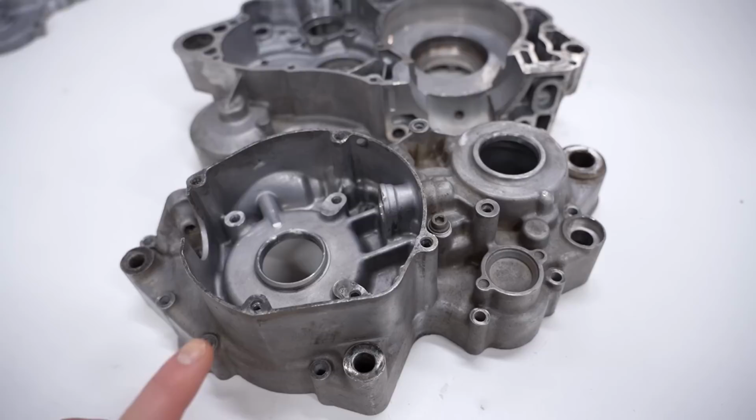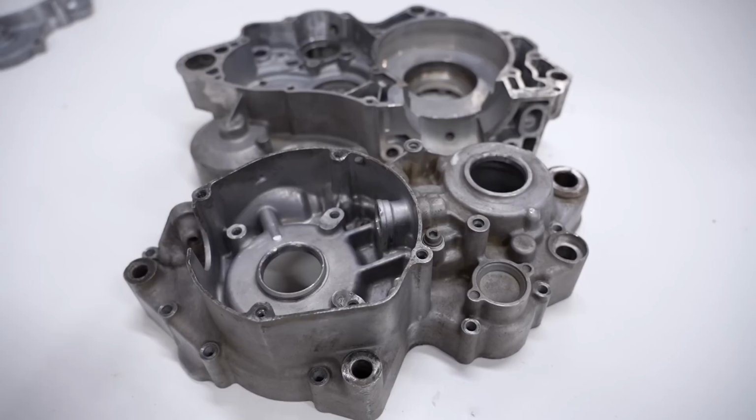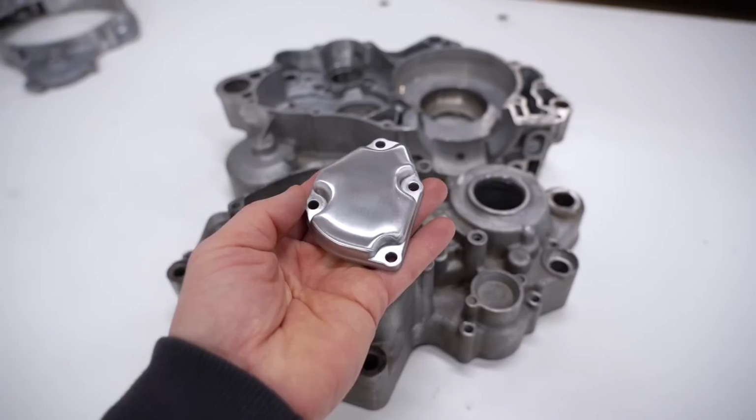And the third option is to use some sort of physical polishing or buffing. So like cleaning wheels, wire brush, Scotch-Brite, steel wool, that kind of thing. That is the approach I'll be going with these. Now, the reason I'm going that route is because it's cheap. I can do it here. And I love the final result of it. It is definitely my favorite. You end up with something looking like this, which is absolutely epic.